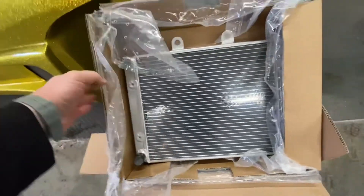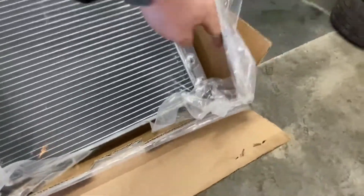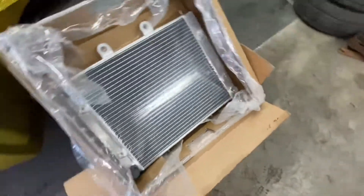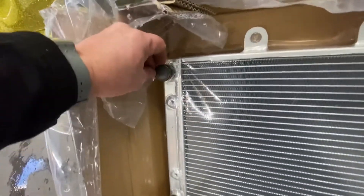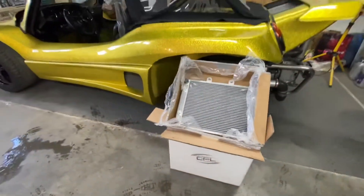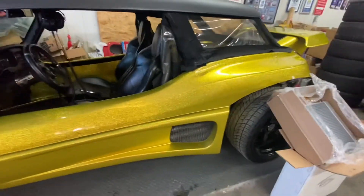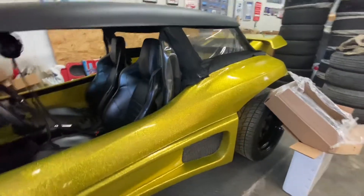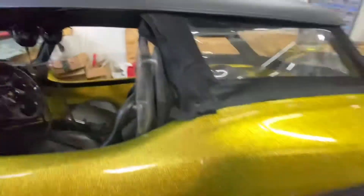It's a double-core aluminum radiator, and I mounted one right-side up and the other one upside down. There's a vent hole that normally has a plug — I borrowed the plug to keep a spare. The only downside is they're one-inch inlet and outlet as opposed to an inch and a half. But honestly I've had zero problems with cooling. The only cooling issue I had was when the fan fuse blew because I was running too low an amperage fuse — when the fans ran at high speed too long the fuse blew. But water temperature sits exactly in the middle and doesn't budge.